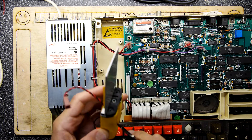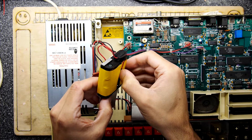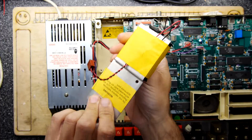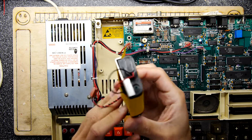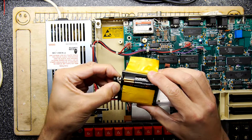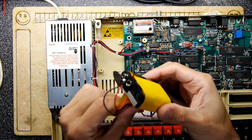Take your knife and cut through there — and you'll discover, probably like this one, crusty AA cells. They are just normal alkaline batteries. It does say on here to replace the whole thing as it's not a serviceable part. But you can service it, and that's what we're going to do. Unplug the battery snap — it's just a nine-volt style connector, which is quite neat — and that allows you to remove this whole thing.